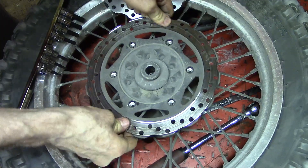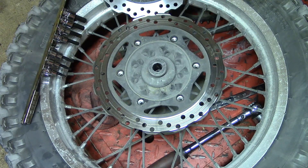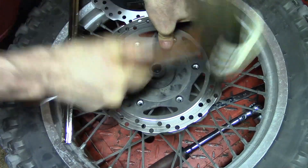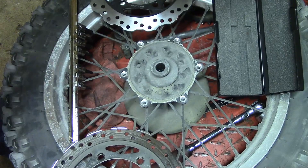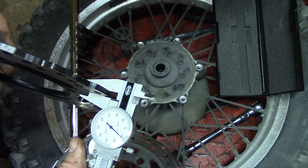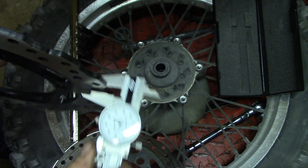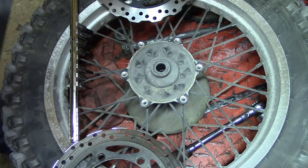I'm going to take this off. Let me grab a mallet. Just to show you, you can see the thickness of the new disc is around 210 thousandths. The minimum should be 180 thousandths, so I've got plenty of room - there's plenty of room for wear.